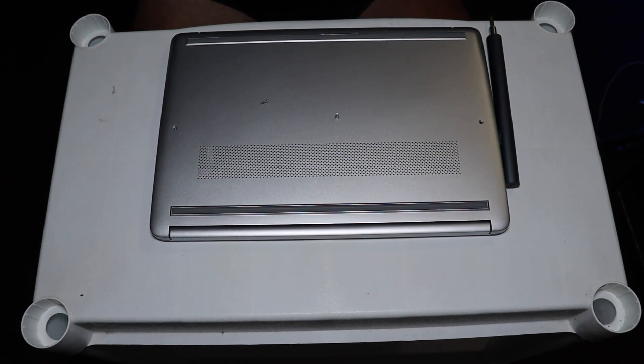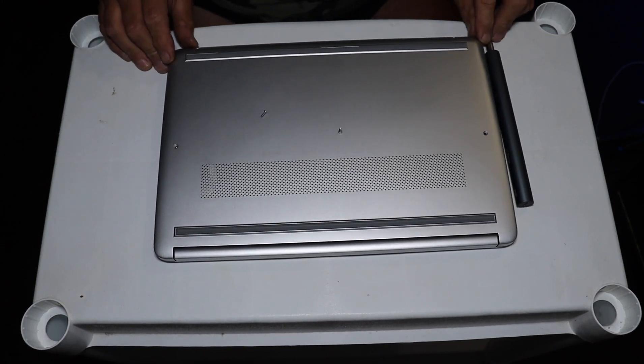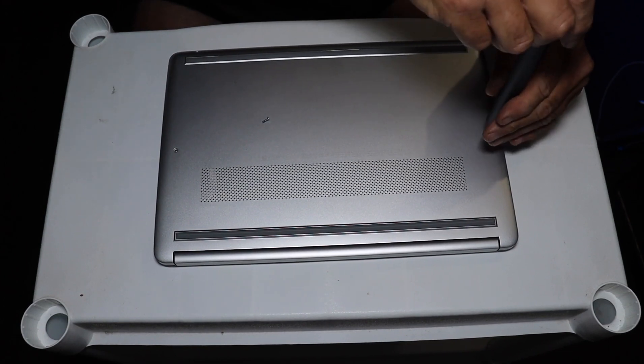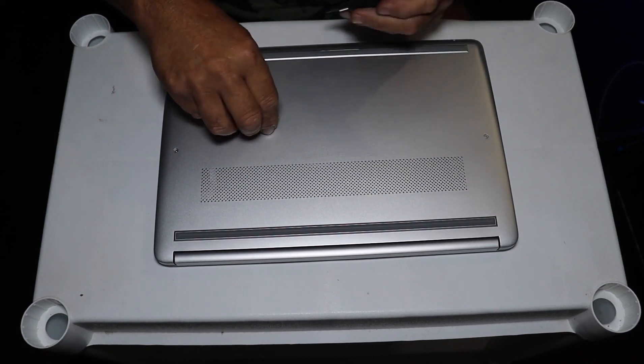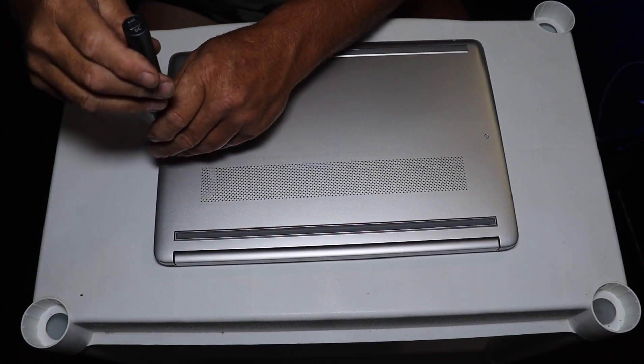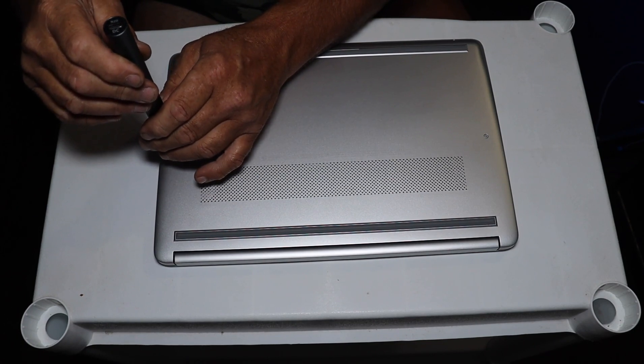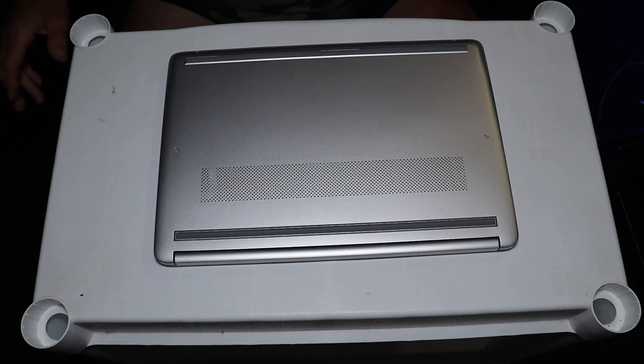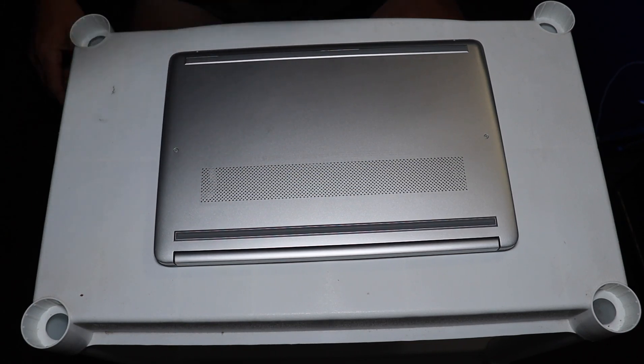That's convenient and quicker than doing this all manually by hand, which is a royal pain. Your hands can cramp up, and as you get older, your hands are going to cramp up. Now to put it back in, just simply put it in there and go until it stops. At this point, you can choose to give it a little bit of extra torque, or you can just leave it. It has plenty of stopping power for laptops, and you don't want these small screws super tight because you could easily strip them out. Maybe just a little bit of extra snugness manually.